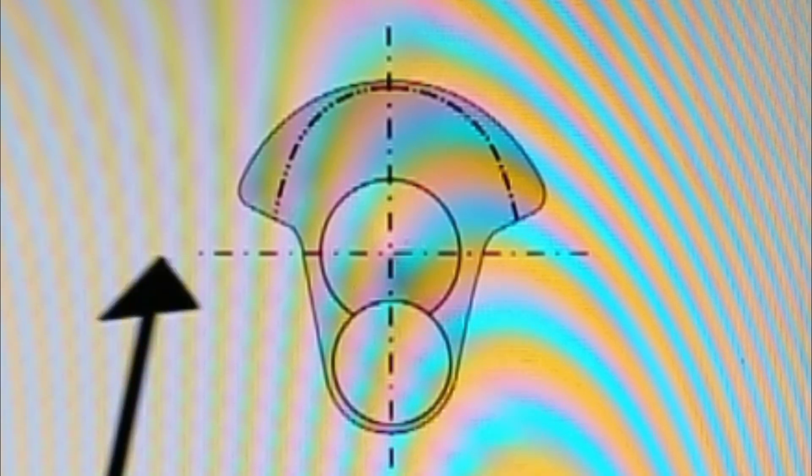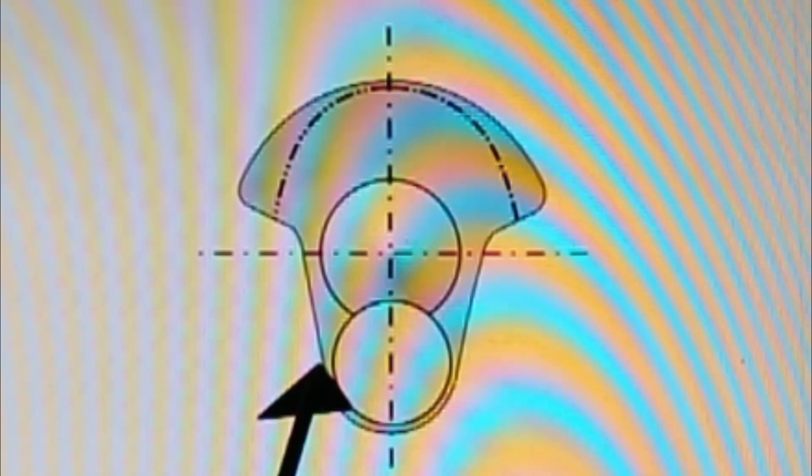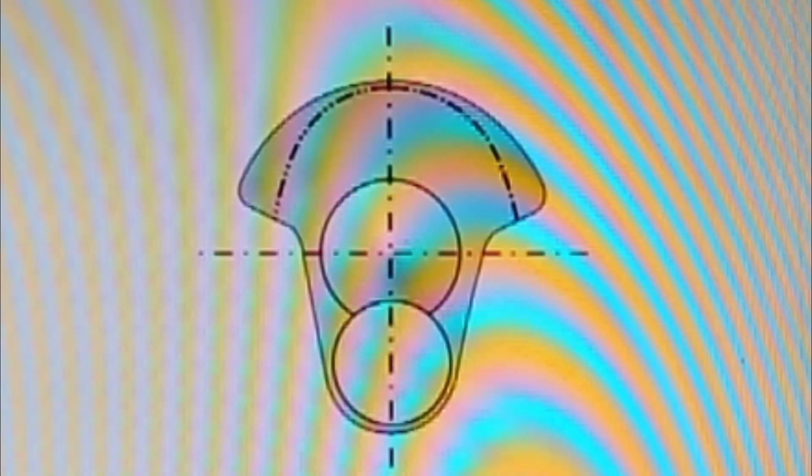I managed to take nearly half an inch off of here in the lathe plus metal rounding this off here and knife-edging it. I put a hole in here and also here — on a lot of cranks, especially forged ones, it gets very untidy. So grind the metal off here and just leave that bearing surface there so that you lighten this end as well. If you look at your crank you'll see a lot of places metal can come off — that's the way to do it. I took the crank up to show John Callis what I'd done, and we put it on the Callis Moment of Inertia machine. It turned out my cast iron crank actually had less moment of inertia than any of the commonly available lightweight race cranks.